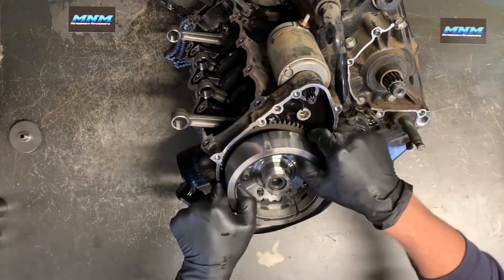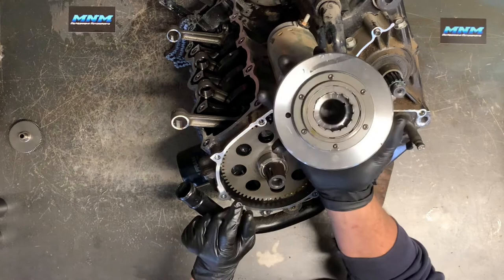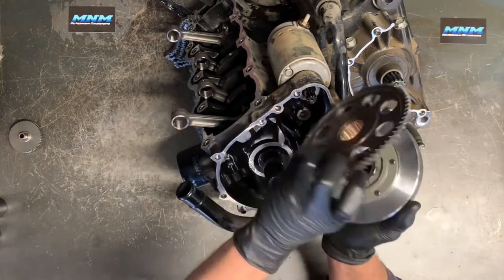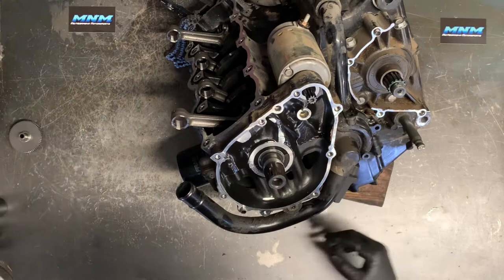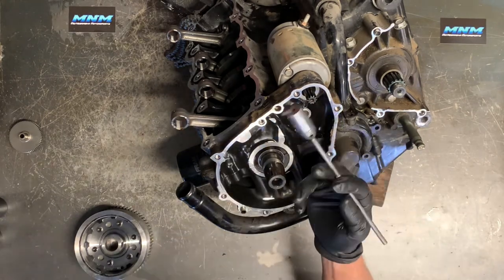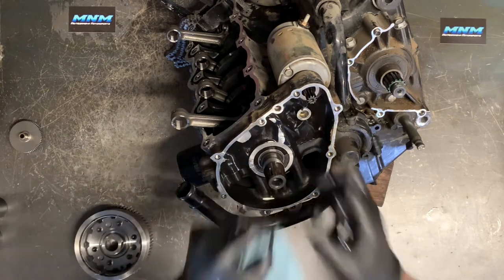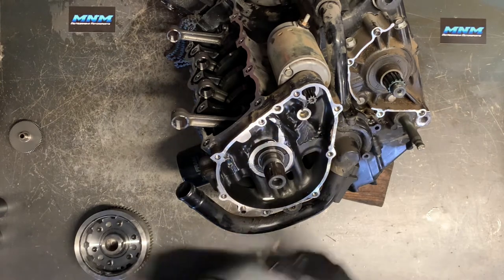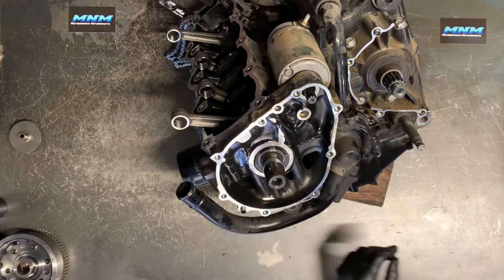Make sure the teeth on your starter are good and the teeth on your one-way gear are good. Setting the starter drive aside, we've got the flywheel here — you heard something fall out, so make sure you grab that before it goes down into your bottom end. Here's your one-way bearing and the gear. Set that on there and spin it — it'll only spin one direction; the other direction spins the whole flywheel. I did drop that keeper down into the crankcase, but I can see it — grab it with a magnet. When going back together, slide that keeper into place, tighten that bolt up, and I like to use Loctite since that flywheel spins at the same rate as your crankshaft.